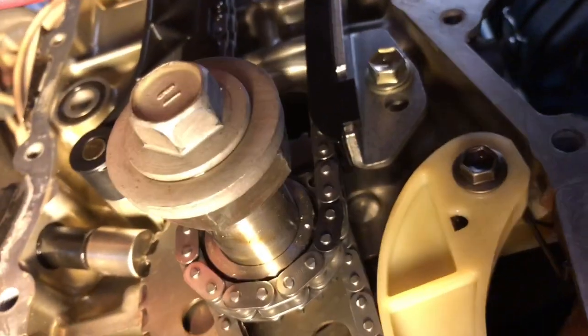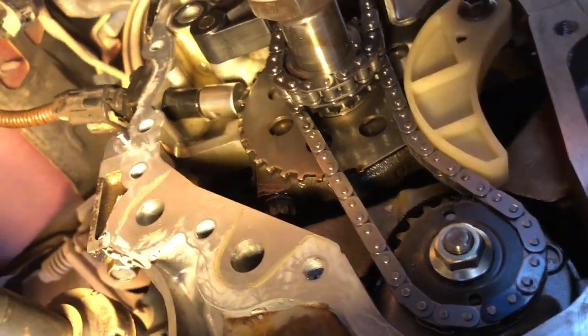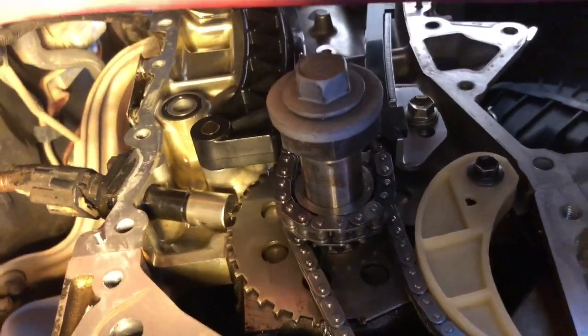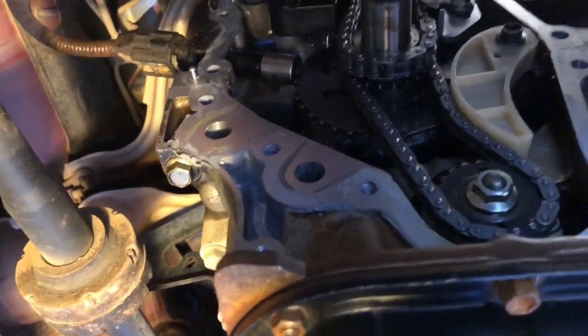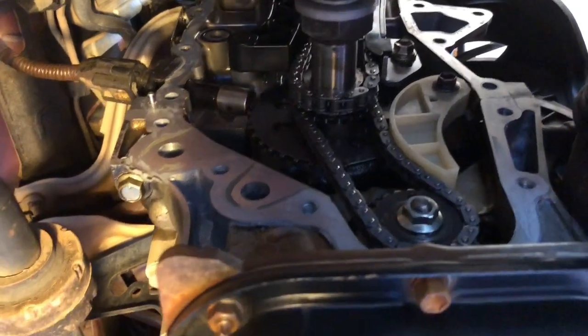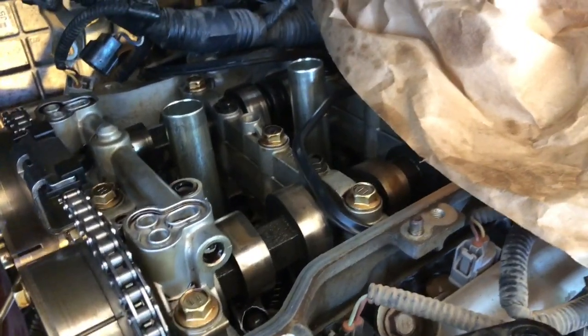As long as you have no erroneous slack in the timing chain against the rails, this is correctly set up for proper camshaft timing. This is an interference engine, so this is not a time to guess. If you're uncertain, turn the engine over very carefully with no spark plugs so there's no compression. This chain wants to snap around because the camshafts have load on them. When you consider the valve springs holding open a valve, if not for the chain, the cams would snap into a different position — they wouldn't just sit where you leave them.